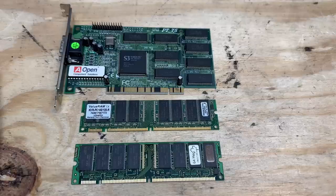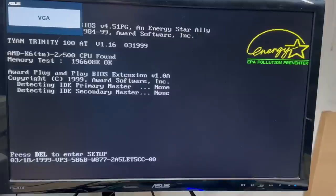Got a DOS boot disk in — let's see what it does. Okay, that's weird. Got some slow beeping, seems to be slow beeping to infinity. Nothing changed except for inserting the DOS boot disk, so let's do some investigating. I stripped everything down and couldn't really isolate the problem, so when in doubt, clean up all the edge connectors. Well, that did the trick.